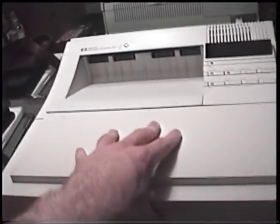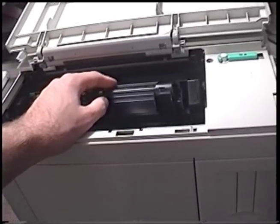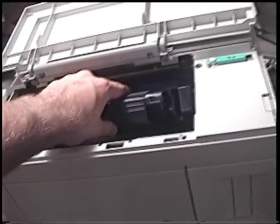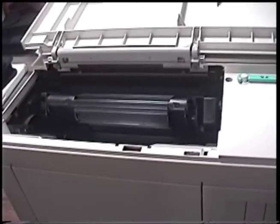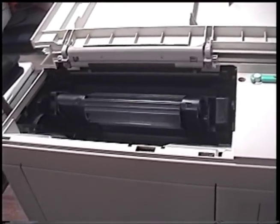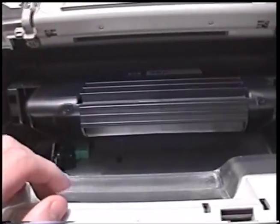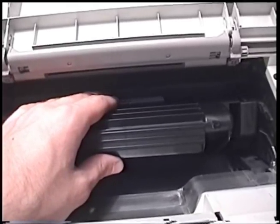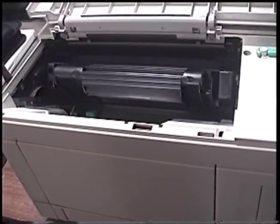Here's something interesting I noticed when I had this printer apart. If you watched the last video, you'll see a part where I have the toner cartridge out and I started printing a test page with the toner cartridge out - which it's not supposed to do. The cover was open and the cartridge was out, and it was starting to feed paper through. The printer's firmware must have got confused, because it's not supposed to attempt to print with the cover open - and definitely not with the cartridge out. Having the toner cartridge out is supposed to throw an EP cart error.